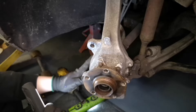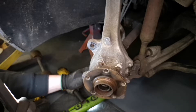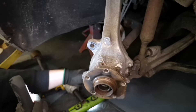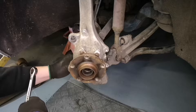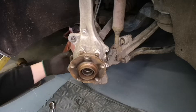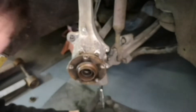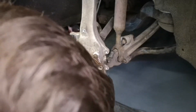I'm going to unbolt the bottom of my arms so I can take the driveshaft out properly. I've got a really good second-hand shaft to try — occasionally there is a little bit of CV clicking noise. I've got a driveshaft off a low-mileage A6 from a breakers which looks in really good condition and feels really good. Unfortunately you can't get a socket on this nut on the bottom arm, but the arms have all been replaced relatively recently so everything just slides off nicely — it's actually a pleasure to work on.